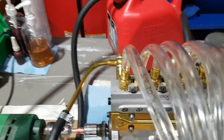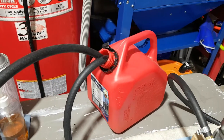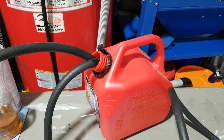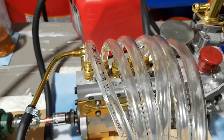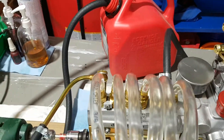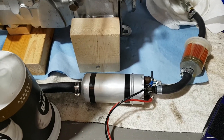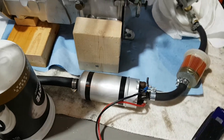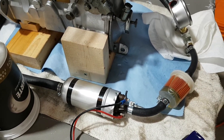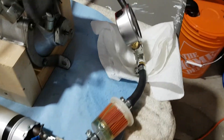I'm going to show you how I've done it — I just use a drill for testing, for the final stages of course. My setup is basically just a normal jerry can with some fuel hoses. The jerry can is filled with diesel, just a little more than halfway up. I'm picking up the fuel from the can going to the pump — that's the 300SEL pump from the 126 chassis. This pump is pressing into this setup right here with the rebuilt regulator and everything.